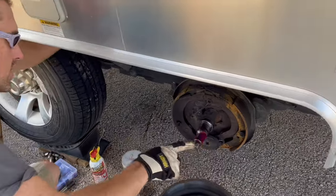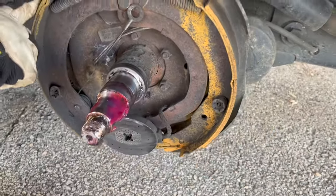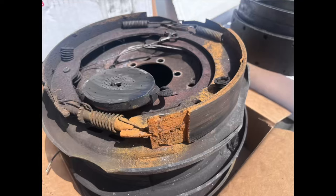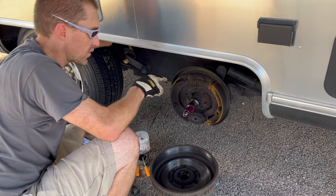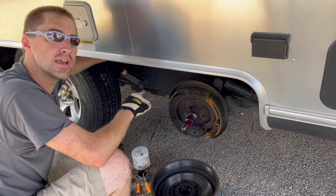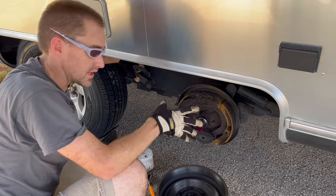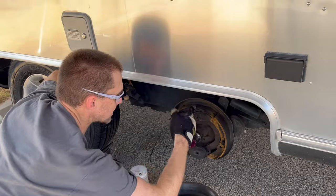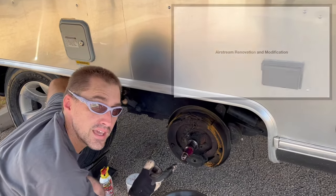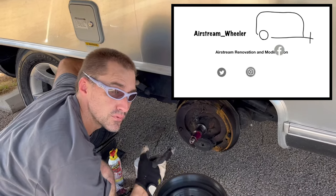I said I wasn't going to film each wheel individually, but I found something interesting on this one. There's rust on the surface of this brake pad — I didn't find that on any of the others. If this brake had really been actuating, that rust should have been scrubbed off during the last bit of travel. The rust in here suggests this brake has been underworking at best and maybe doing nothing. That's exactly the point of why we're doing this — we need to make sure all our running gear is up to snuff. If we replace the backer and make sure the electrical connections are good, we can individually inspect all these brakes to make sure each one is working and adjusted correctly before we get back on the road.